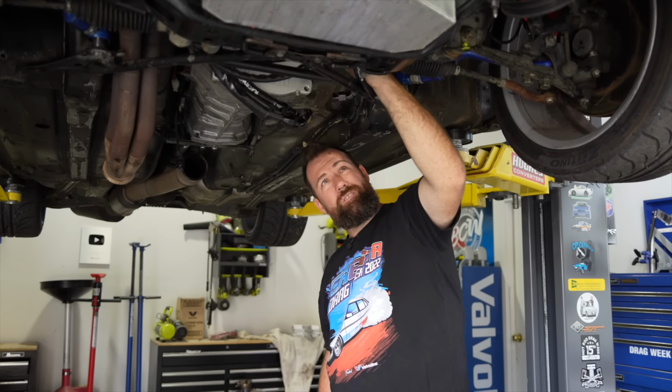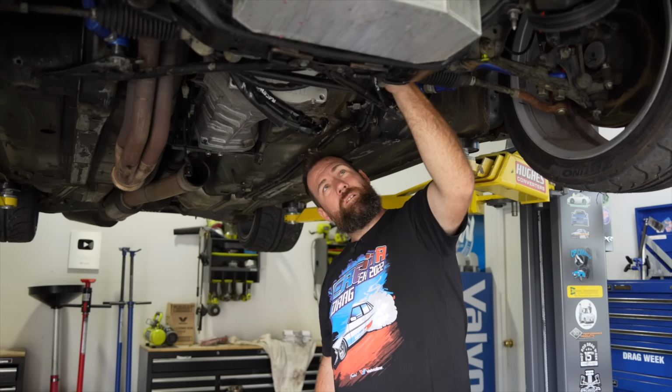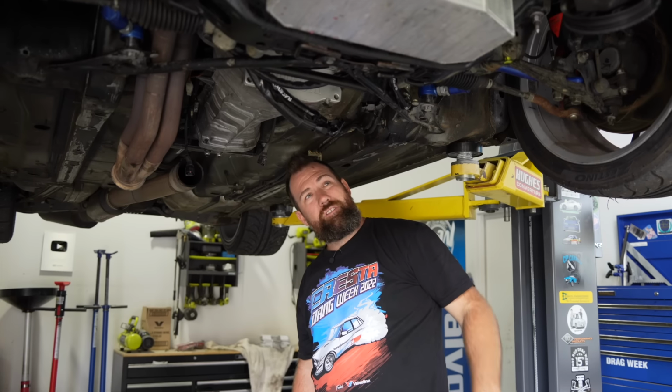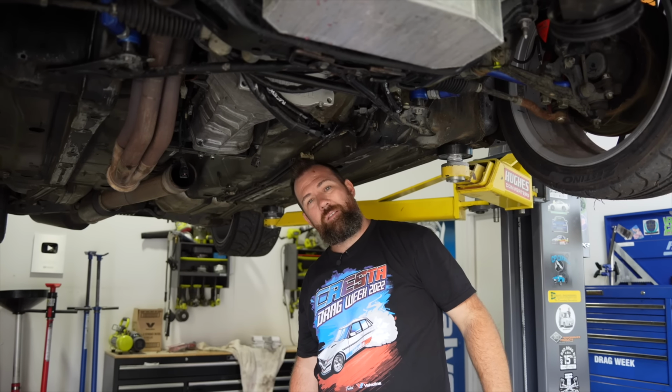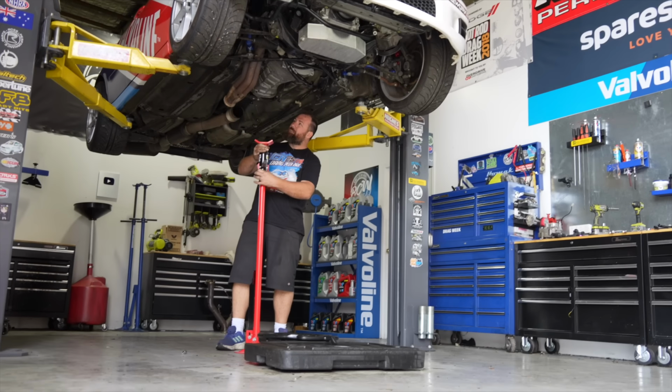I do it on the Cresta as well. The oil drain is another dash 10 and it's actually welded to the sump. So yeah, it gives you good protection of all your threads and fittings when you're assembling or disassembling something as well. So just another thing to keep in mind when you're playing with AN stuff.